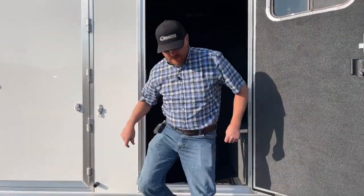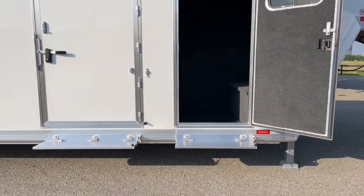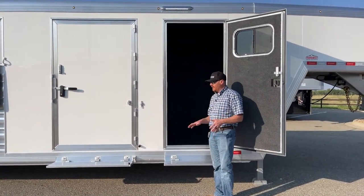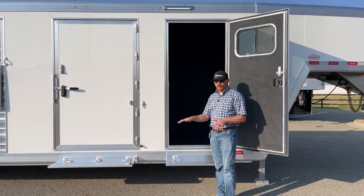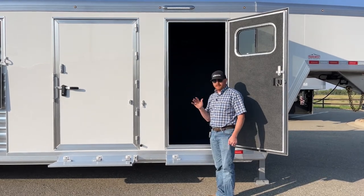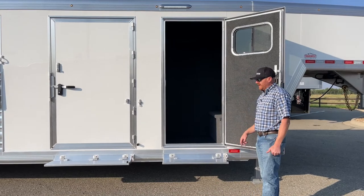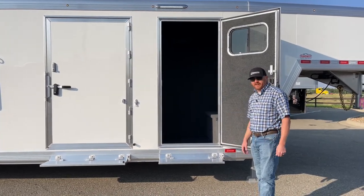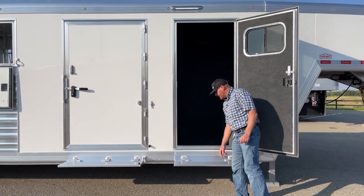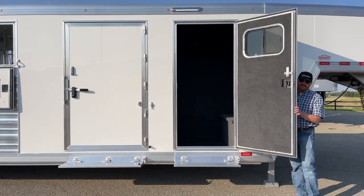You also have this fold-up step right here. We have this trailer aired up, so it goes up about 2.5 inches when aired up. I recommend when you're loading horses or tack, have this trailer lowered — everything's 2.5 inches lower to the ground, steps aren't as big, ramps aren't as steep. These steps are especially useful on 8-wide trailers and tack rooms. There's about an 8-inch difference between the bottom of the doorframe and the top of the step, making the transition from ground into the tack room much easier.